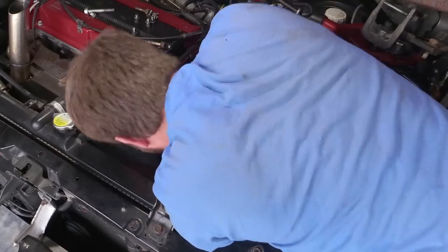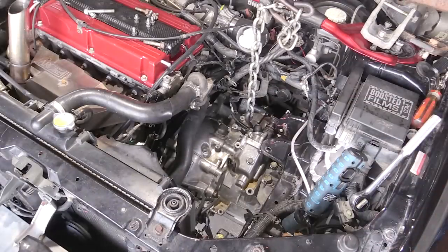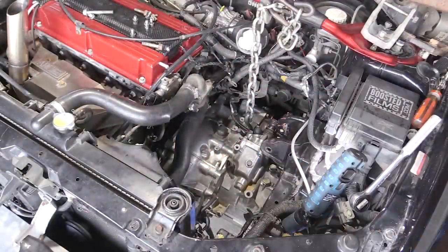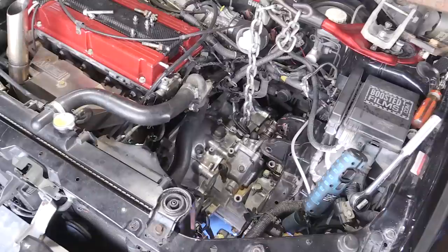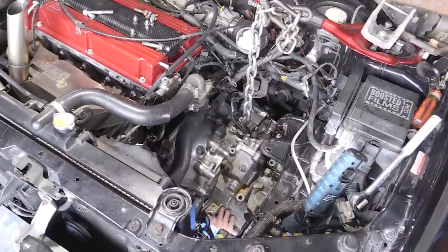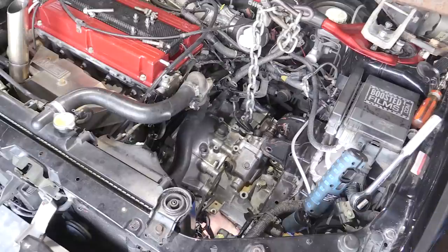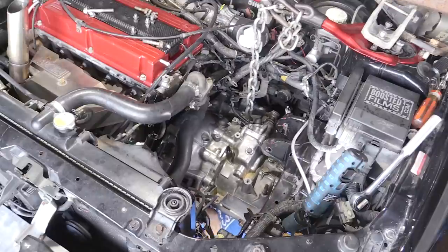It did kind of help — I repositioned it a little bit better and it worked better this way. I got the transmission closer to the firewall and it was coming on a bit straighter. Then I took my time. I lowered the engine down a bit when I could, jacked the transmission up a bit when I could, went underneath the car, and tried to twist and turn it to line it up. When you're raising it up, it's not going to directly line up the way you want it to. You're going to have to twist or turn the transmission to make sure those bell housing bolts are going to line up. I just kept trying different things, taking my time, being patient — and I got really close. And then it just kind of slid on. I could really feel it right at that moment.